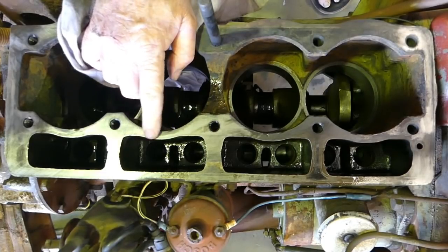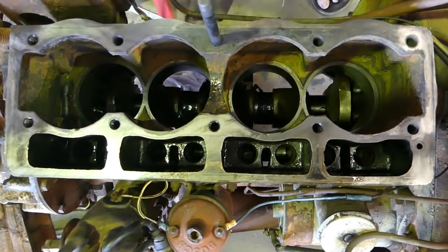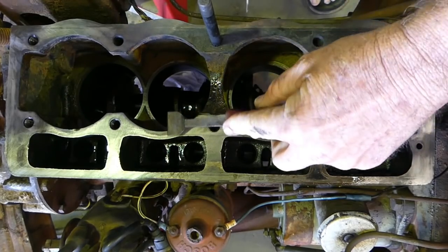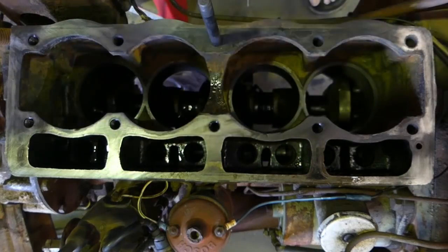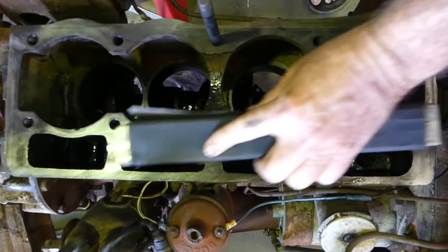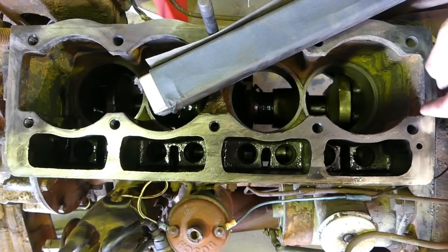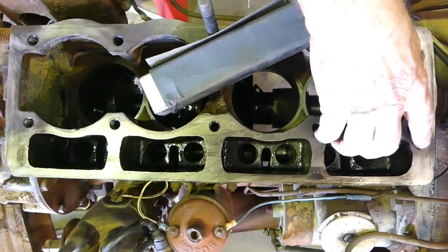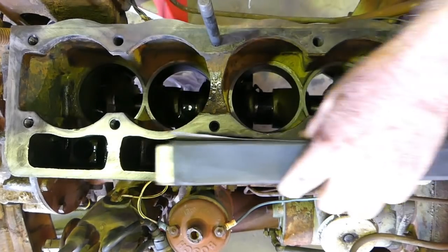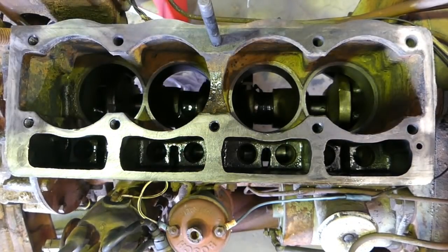This top surface is very important to getting a good seal with your head gasket later. You can see I'm touching all the way around there — even though there's a little rusty shadow, we're not high at all. You can run the scraper straight through there with no resistance, so we know it's clean. You have options — the sanding block is a good tool for getting it clean and straight. This little hole is where oil comes up to the cylinder head; I sometimes pop a little bit of grease down there or tape it off to keep junk out.